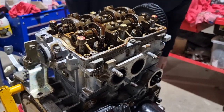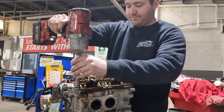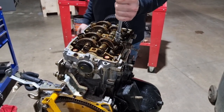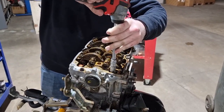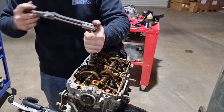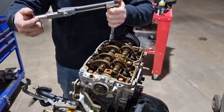You'll also note that I am reusing the head bolts. Now, stretch bolts — you probably assume you should throw them in the bin, but you can actually measure them and see if they are out of spec or not. I normally just use the impact to get the head bolts in until they touch — do not tighten them up like this. There should be a torque procedure included with your head gasket kit, or you can find it in the workshop manual. If you don't know how to use a torque wrench, you might as well just tighten them up with a rattle gun.